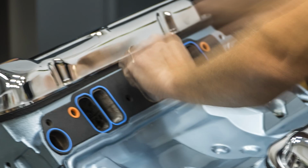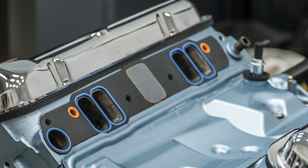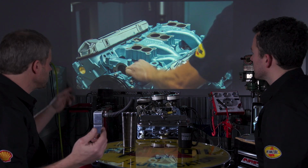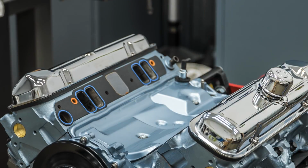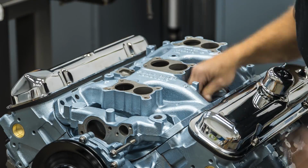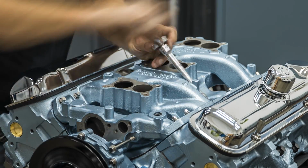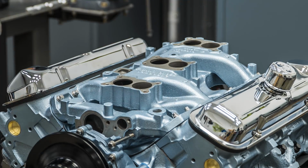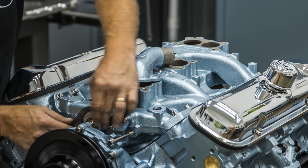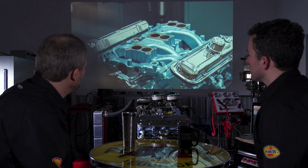Factory heads always have an exhaust crossover, so it takes exhaust gas to the center of the motor, which accelerates the heating function of the engine. So it basically is heating the carburetor up, the center carburetor in this case, so it comes up to a better idle quicker. Okay. And so why are you blocking it off? And it's the choke pull off and that.